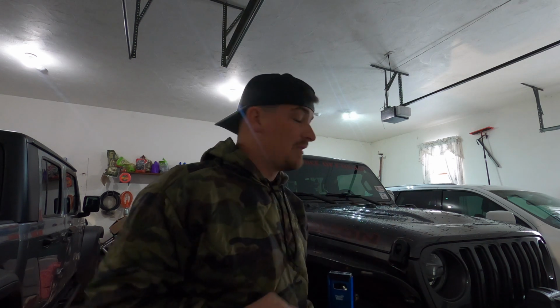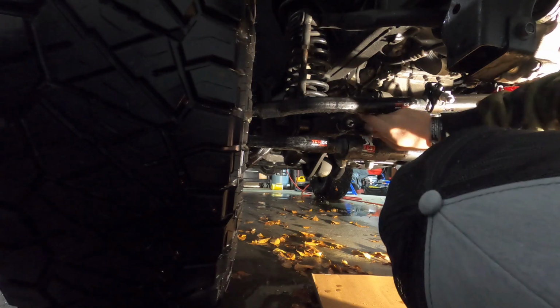Okay, so my axle needs to go maybe about 1/8 of an inch over this way. Not a huge deal. I'm just going to do a half turn longer than it is now. So I'll take the 2 track bars, use bolts through them to make sure they're the same size, and then I'm going to make it a half a turn longer. So that should work out pretty well, I think. Obviously, I'm going to double check the measurements after the fact, but right now I have to get the old track bar out. There we go. Got it.